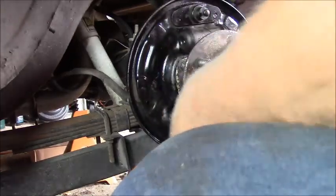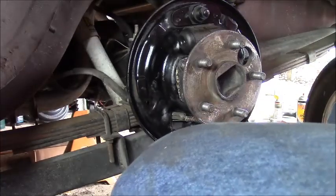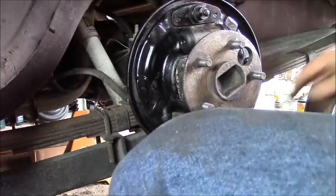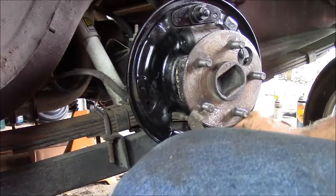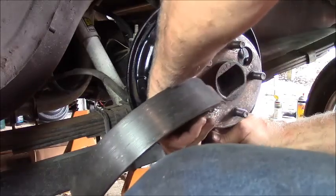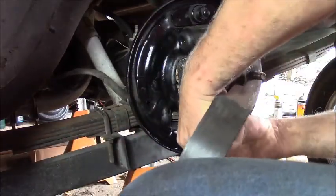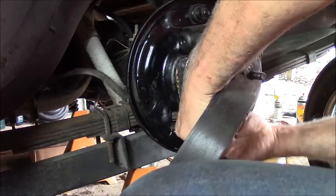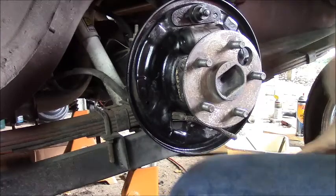The longest shoe always goes towards the rear of the vehicle. In this case the shoe comes way down to the bottom of the heel, which you can see is an inch or so longer than the front shoe - that's just a quick rule of thumb. These can be miserable to get on too, especially with that axle in there. I've got to pull that spring back just enough to get that hook in there - channel locks.